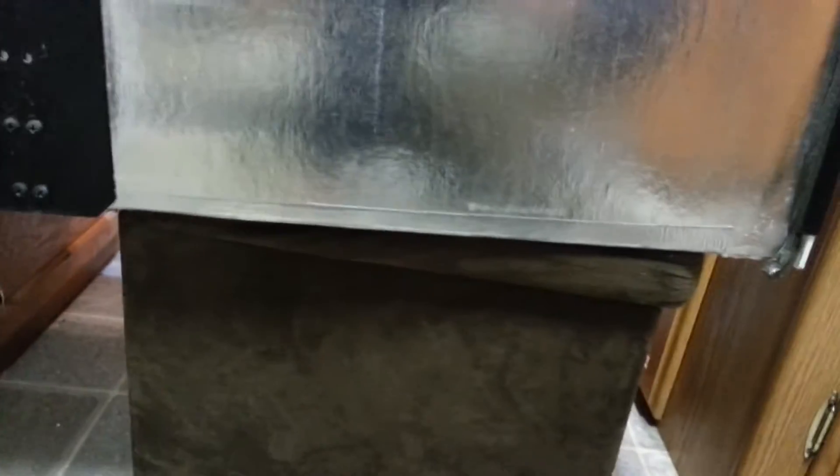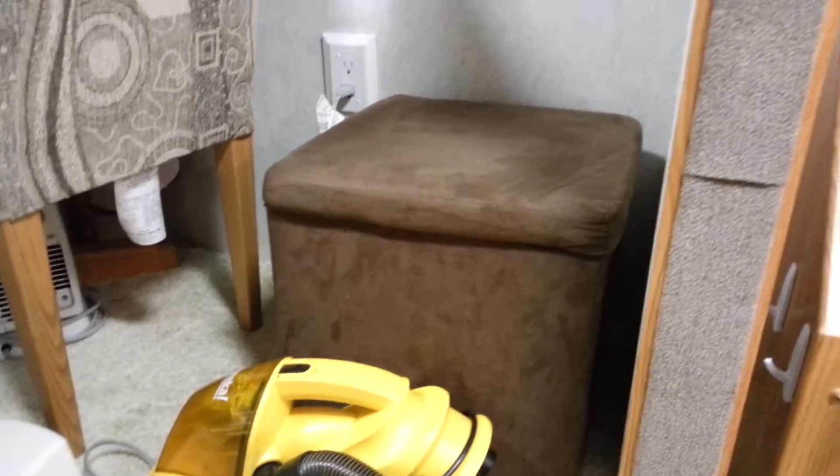Earlier I was talking about that bracket - there's that bracket. Winnebago adds that bracket and runs those screws into the refrigerator. So if you take all the screws out of the front - in the front there's like two screws up top, two screws in the bottom - so there's only four screws that hold the refrigerator in, besides the big mounting screws here in the back which take a 9/16 socket. But Winnebago goes a step further and puts screws up here at the top, and you have to take the roof vent off to get them loose and get the fridge out. Here's another tip: we have these little brown stools that are just the right height. I stick the stool out there in front and slide the refrigerator right out on top of it - exactly the right height. I picked those up at Walmart; great for storage and great for getting your fridge out of that hole.